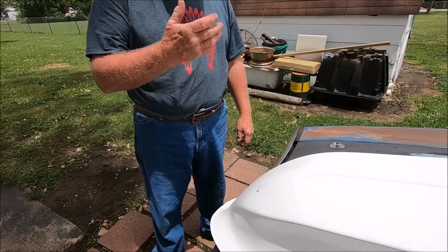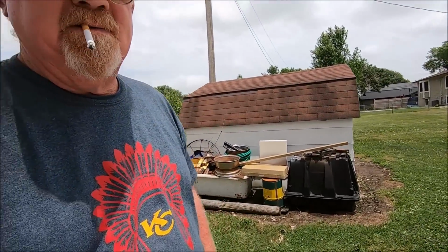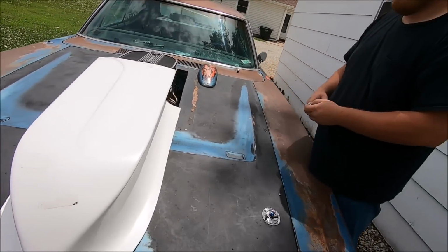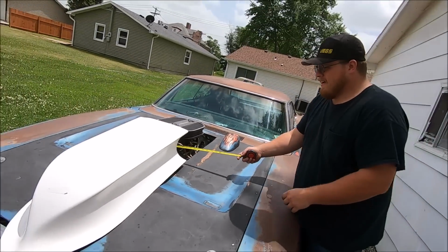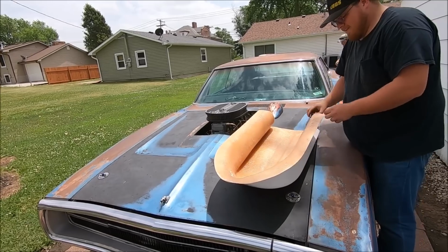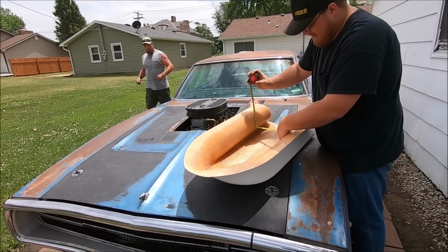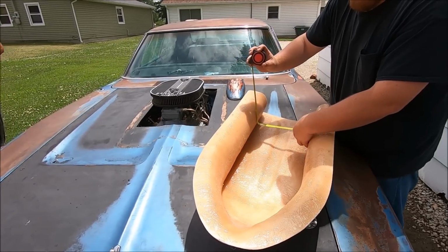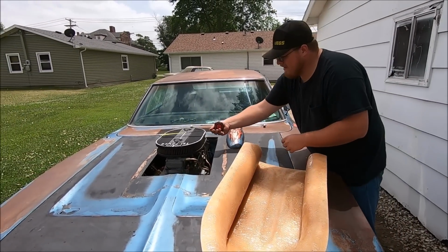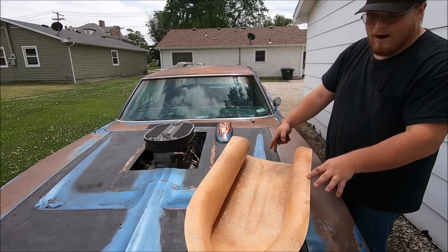Maybe we just need 2 of them. Here, hold this. All right, the screen should stay on. So basically what's got to happen is indention to indention of this scoop. It's only 10 inches wide. You come in here and work the tape measure. Actually, it's less, it's 9.5. The air cleaner itself is 11 3/8, so we need to widen this thing.